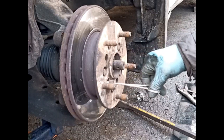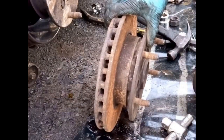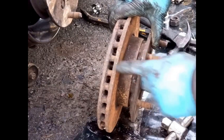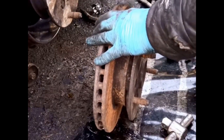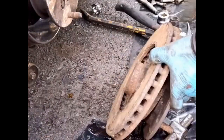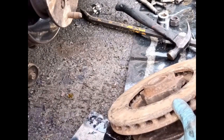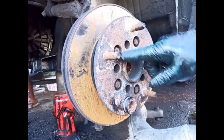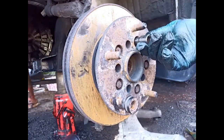Once you set up, basically, look at that. Can you see it? Yeah. So the disc bolts to the hub with some bolts, obviously, and those are those. And then in between, there are these holes that allow me to unbolt this bearing from the bottom of the suspension leg. We need to take these bolts out. We don't want to round the heads off.